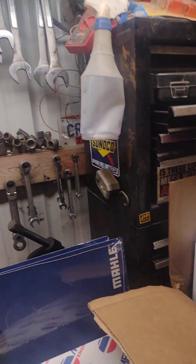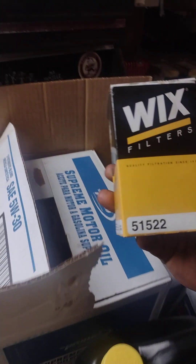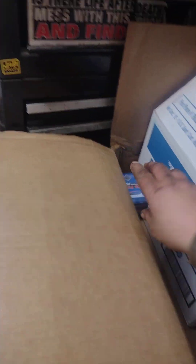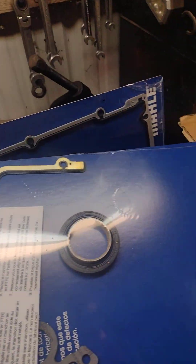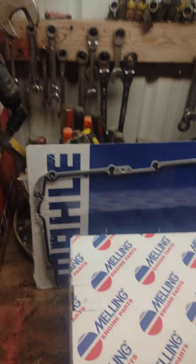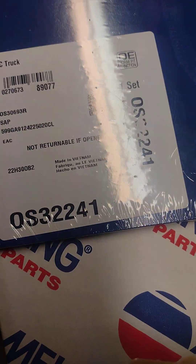To do this job, we're going to get synthetic blend oil, five quarts of 5W-30. We're going to get a new deeper Wix filter, part number 51522 — because you won't find it unless you look for a different car. This right here will be my timing cover set, equipped with water pump and a few other O-rings. That one looks like the one that goes onto your oil pickup tube. Brand new oil pan gasket — pan gasket part number and timing cover gasket part number for you.